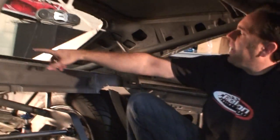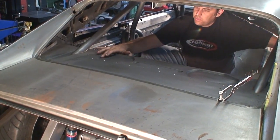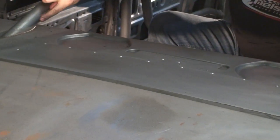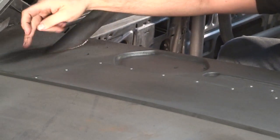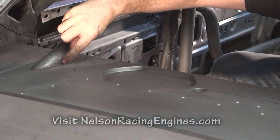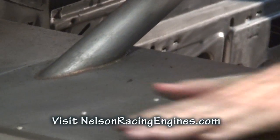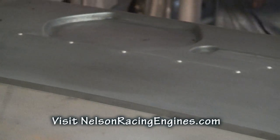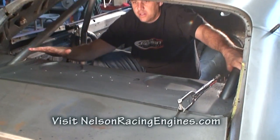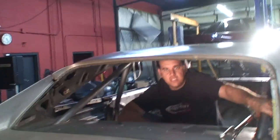In the package tray area, we filled in the rear speaker tray because we need a steel firewall to be legal. We cut the panels out, used Pullmax flanges, metal-finished and welded everything so the cage is super tight to the rear speaker tray. The blocked-off piece in the back is all metal-finished — it shows the quality standard the whole car is held to; it's not just one part getting details, the entire car is.